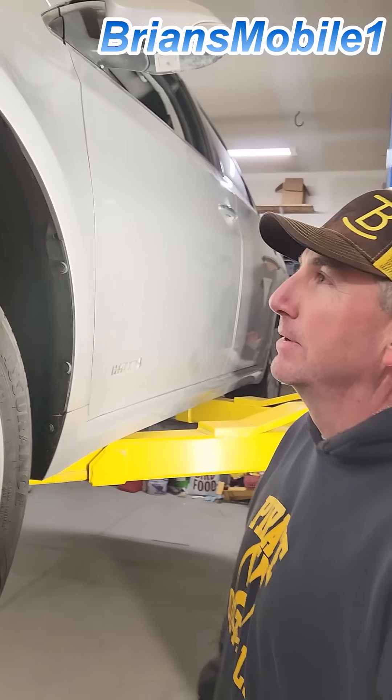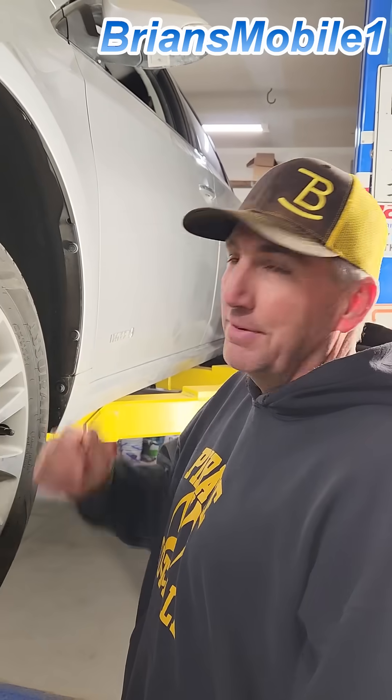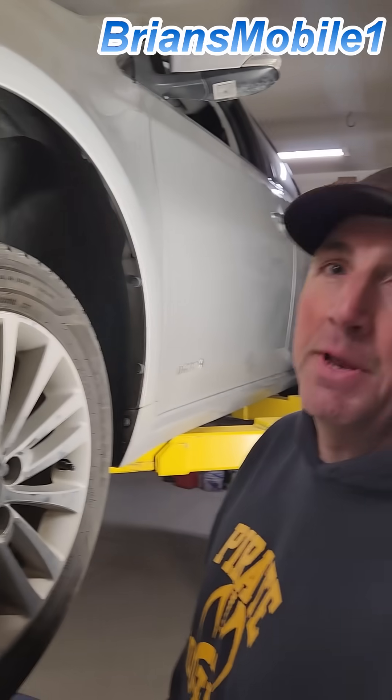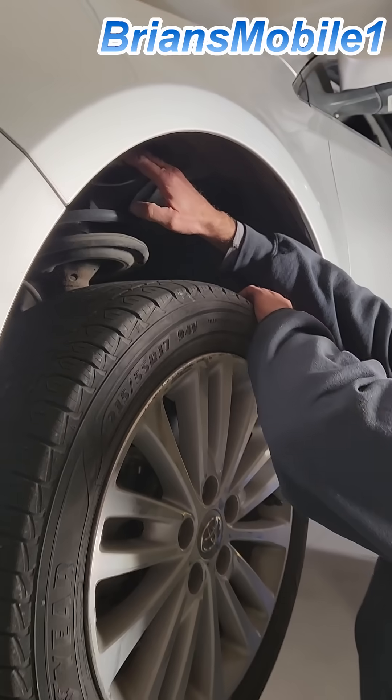Yeah, it's alive, isn't it? The other side — did it feel alive? And what does the customer describe when they're in this? It's a loud thumping noise. You switch tires, which is the right way to isolate that, because tires will do the same thump thump. But the spring — that's the telltale.